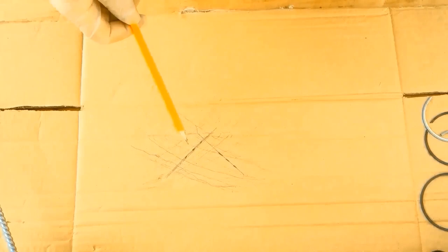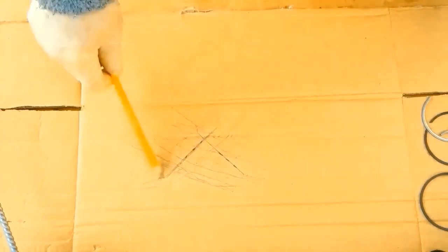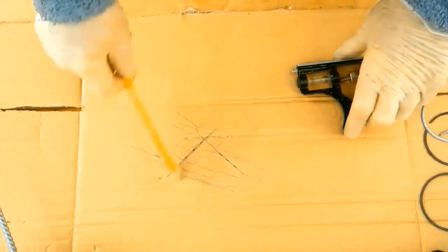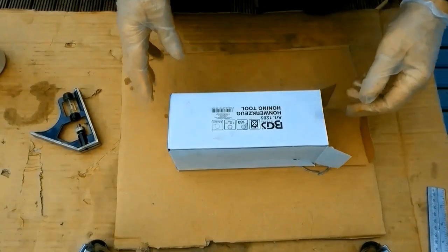If this is not done, smooth bore wall, smooth piston rings, a layer of oil between, and never the twain shall meet, as Robbie Burns might say. 45 degrees gets a mention, and 30 degrees gets a mention, so anywhere between the two should be good. Now I'm going to take a chance on this.